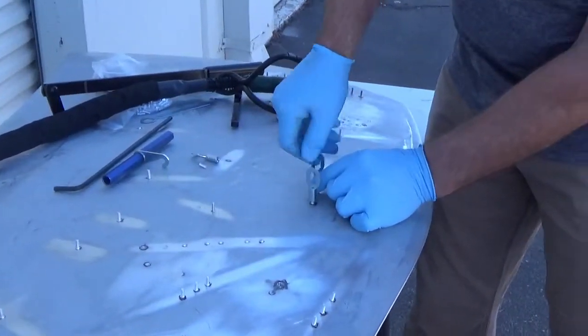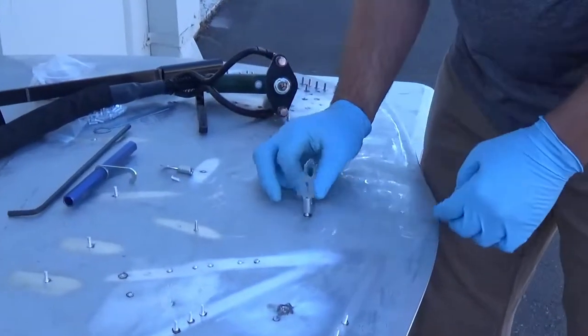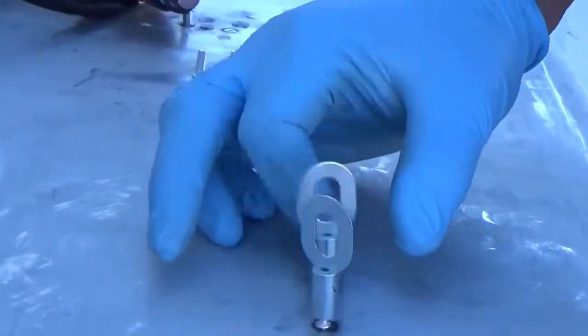Once you've set your steel stud, you're able to pull on smaller dents with the T-handle while hitting the crown of the dent with your hammer.